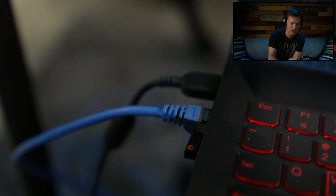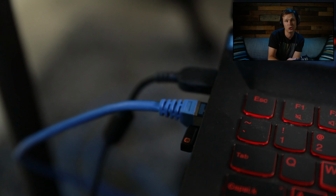Now, as far as connections go, I've tried connecting directly to the computer with USB-C and the ATEM software control. This software control panel works great. It's totally fine, but it works. I've also connected the ATEM Mini Pro directly to the laptop through the Ethernet port, and streamed that way as well. The way you do that is, your Ethernet port is then taken up by the cable that's plugging into the ATEM. So your only way to connect to the internet at that point is through Wi-Fi.